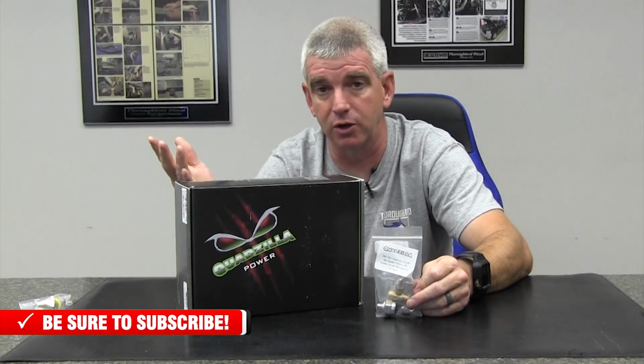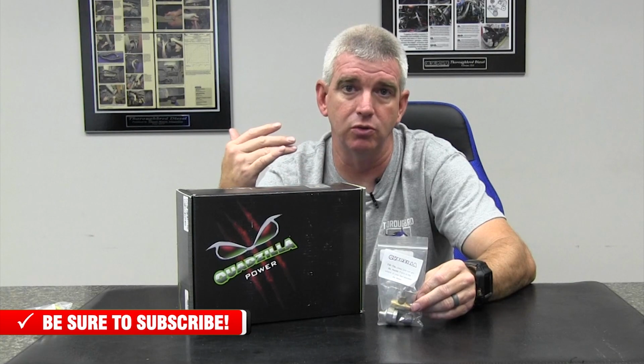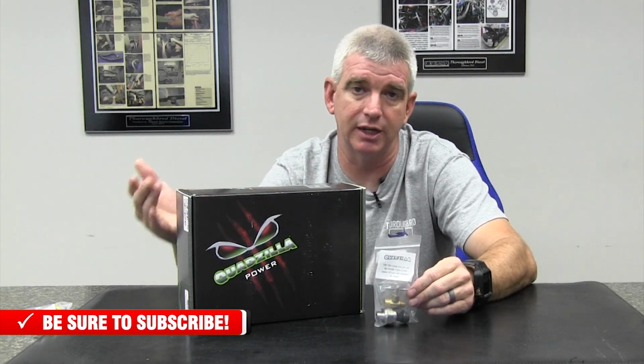However, it's just as critical, in my opinion, on the common rail trucks. Low fuel pressure can lead to wreckage of the common rail fuel system, worn out injectors, worn out CP3 pump, and so on. So lift pump pressure is just as vital on a common rail, again in my opinion, as it is on a VP44 truck. But as we all know, with the VP44 guys, it's the first thing everybody knows: I got a VP truck, I gotta watch my lift pump pressure.